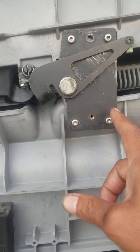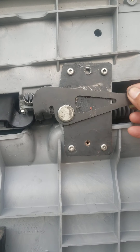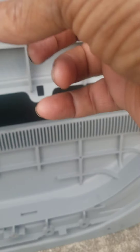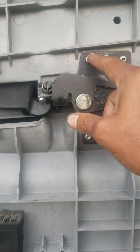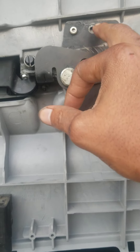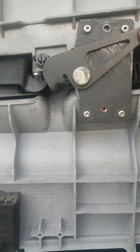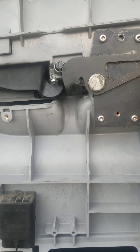As you can see, I have transferred all the hardware over. This is the latch mechanism here that the rod goes on, that goes down to strike for the door to unlock. When this here breaks, when these things break, it causes this whole plate to move. And when that plate moves, you don't get accurate movement of this latch. So that's where your problem comes in.